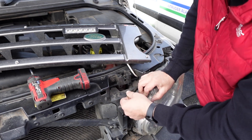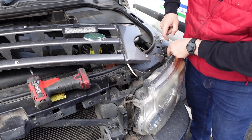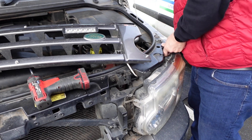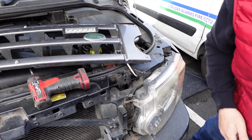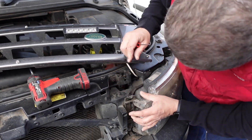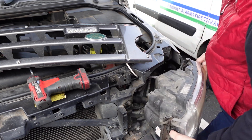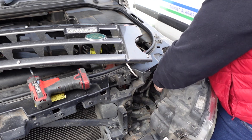Removing the headlights is pretty simple - it's just got these tabs, but you'll find that if you just pull them straight up they won't come free. They don't come free straight away; you've got to wiggle them just to get it in the hole, so you go down just a touch and then you'll find it'll just pull out easy. Then just remove the connector.